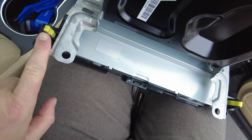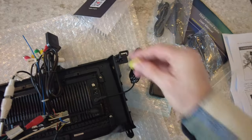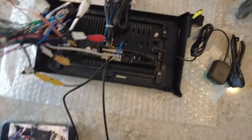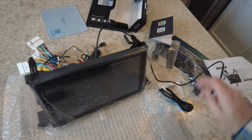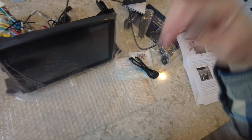One tip — make sure to remove the little yellow tabs that are on the factory stereo. Those will transfer to the Vibex unit. I got the yellow clips installed and the wiring harness installed, so let's get ready to pop this in the car. I also installed the extra USB plug here in an effort to see if there's a way to upload the Toyota logo so that when you turn it on it looks factory — a bit of a guess, but we'll see how it goes.